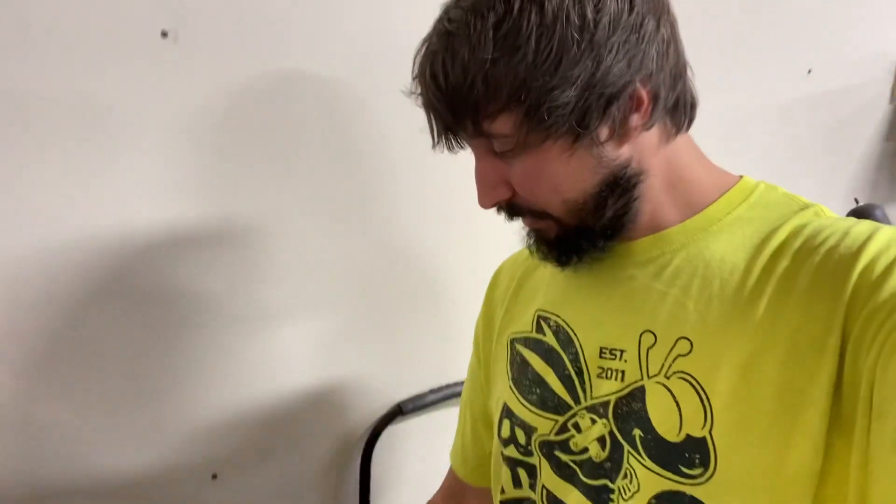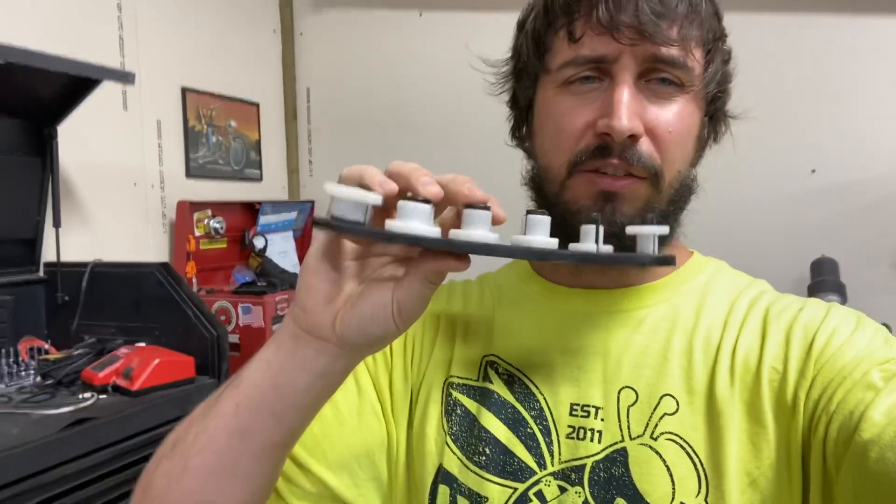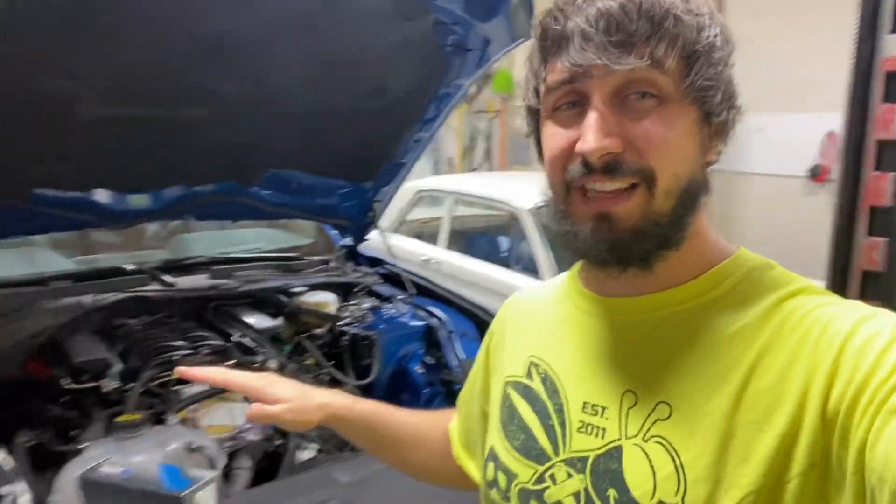Let me show you a tool that'll be nice to have here. These are fuel line clip removers - fuel line removal tools. You will need those, and I'll show you the exact size when you get to that step. Take your time with these. Make sure you do lubricate up the new O-rings before you install them. Depending on what size of injectors you install, some are different heights, so sometimes you need to have a spacer. I don't think the ID-1050s will, but some do.